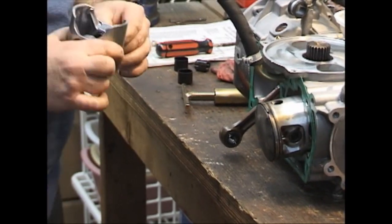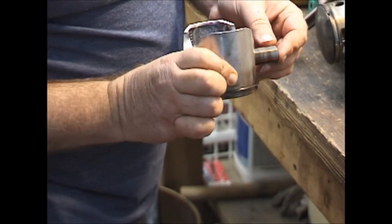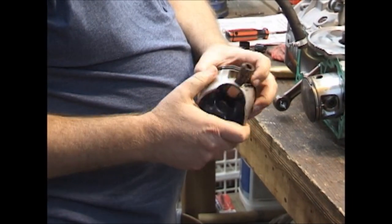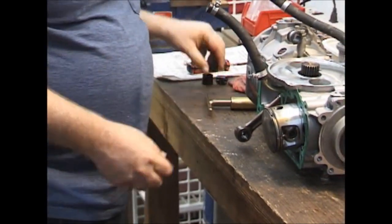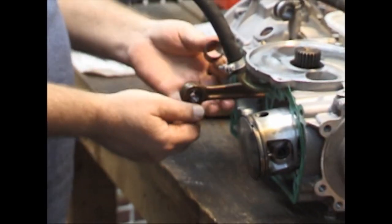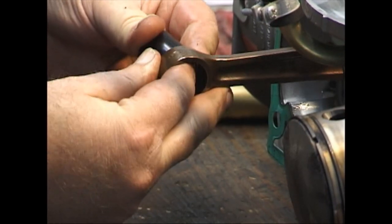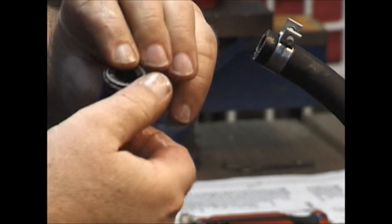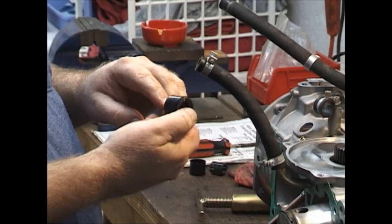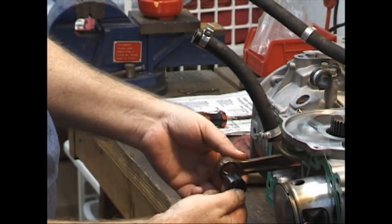There's your piston. There's some discoloration from heat, there's some carbon underneath the piston. If these pistons still fit, they will be decarbed before we put it all back together. Getting back to this, that spring inside there is holding the whole set together. It gives you two of these with the puller — all you do is set that over the end and push the bearings into it. That way technically every bearing is exactly where it was before; you haven't swapped ends with any bearings, you haven't gotten them out of order. This is just like they were in here since new.